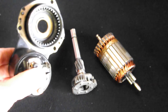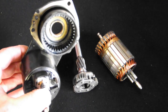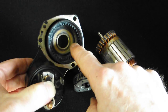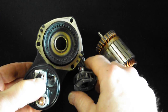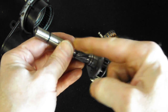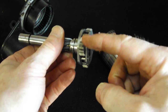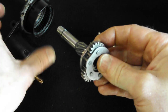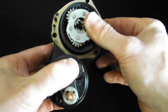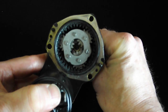Here's a quick introduction to a planetary gear set. This is part of a pre-engaged starter motor. You can see around here there are teeth fixed to the housing. This section has the drive shaft — this is the output — and there's a cage on the back holding the planetary gears, and this fits inside the housing so the teeth will mesh up.